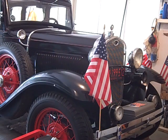Also, you've got to check very closely on the big electrical cable going from the negative terminal of the battery forward to the starter post. Now, that carries all the current to drive the starter. And if that thing shorts out, there's no fuse involved or anything. It just is a very bad short, and you'll burn your car up, your house, or whatever. So that wire has to be protected.